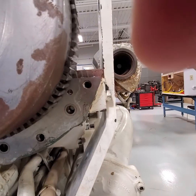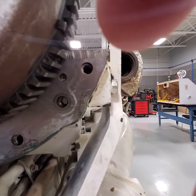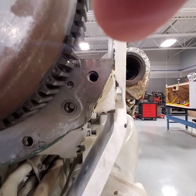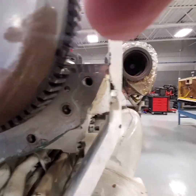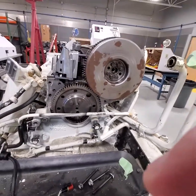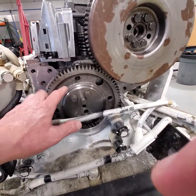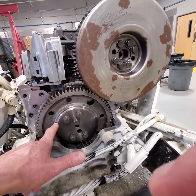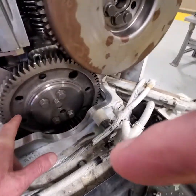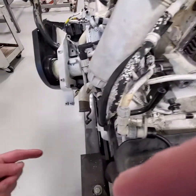I'm going to zoom out a little bit to get a better visual. That's pretty good — I would say it's pretty much dead center at this point. What that means is the gear train is timed. This gear is an idler gear on a giant bearing. You have a drive gear down here and another gear behind it that drives this gear, which then drives the camshaft. So the crankshaft down there is timed, which means the gear train up here is timed.